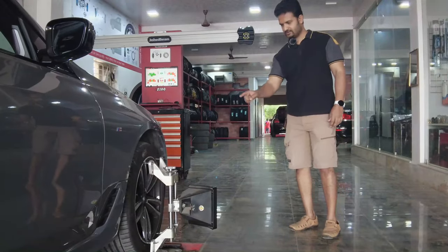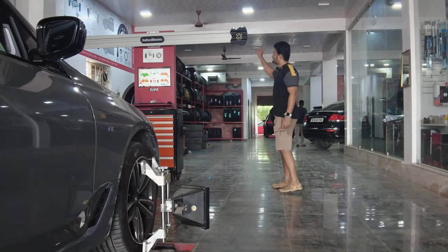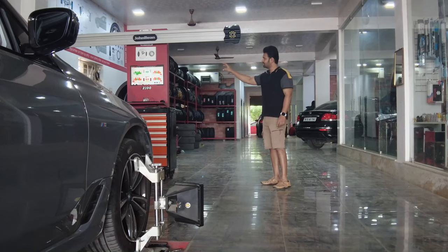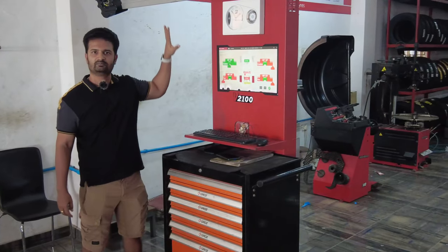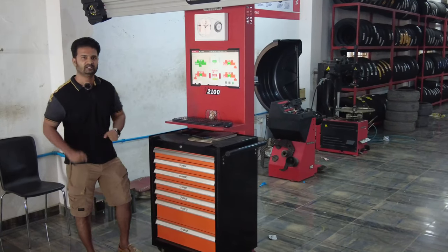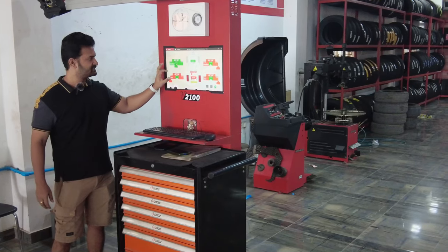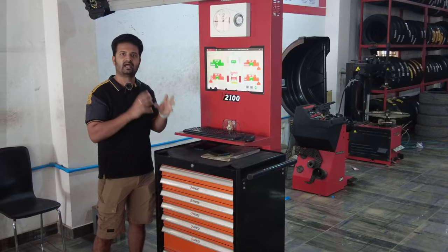They've fixed sensors to all four wheels. These sensors send infrared signals to each other and the feedback is shown on the monitor, which is how the system determines the angle at which each wheel sits. The whole setup is used to check and correct the wheel alignment. The screen shows the measurements of the current wheel angles, and the technicians use this information to bring the wheels to their proper alignment angles.